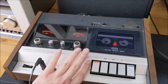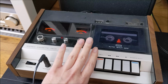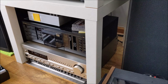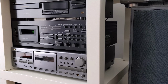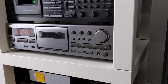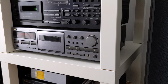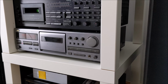So some of them diverged, but if they did adhere to any standards, it was the IEC1, and that's what the Nakamichis are also. At the time, that's what they decided on as well. Even when they were kind of in the 80s, they wanted to do their own thing. Whereas newer decks like JVC, like this one right here, they're IEC2. Prague 1981, I believe. That's the standard. I don't remember all the names, but probably link it in the description below.